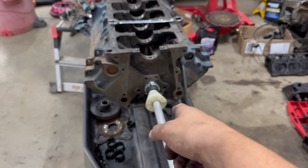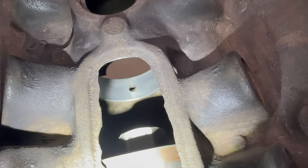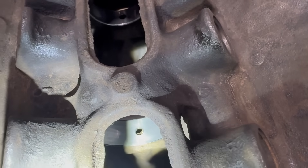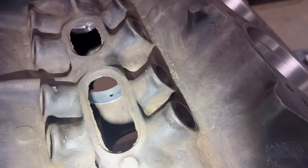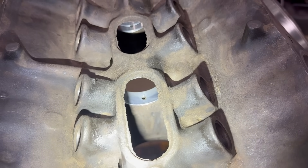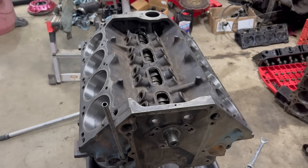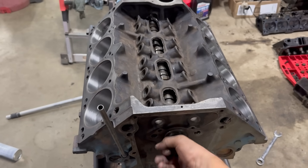For the front one, there's nothing for the centering cone to sit in, so you kind of just have to use the force. I put the number three cam bearing back forward as far as I could — you see it's flush here on the sides. I can't do anything else, and it's still obscuring that oil hole by about a third. It's just going to have to be what it is. Moving them back forward without ruining stuff is tough — don't send them too far. I can't get these holes to line up perfectly — that bearing is pretty well centered with it, it's just going to have to be good enough. Obviously there will be oil flow there, but it's slightly restricted, and I don't love that. If I were way more talented, I could probably get in there and open up the oil feed holes a little bit, but I'm not. Moment of truth — does the cam do camming? Yes, it does, very nicely. I'm happy with that — it's good enough for what I'm doing.